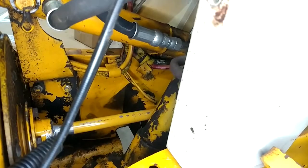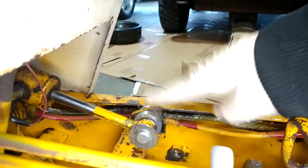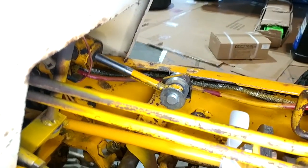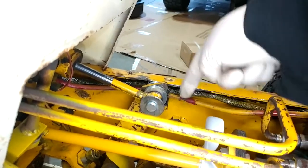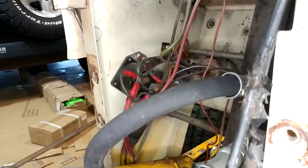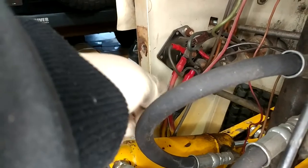The clamping for all the wires is right under the hydraulic lift cylinder — those are wires going forward and those are wires going backward. My linkage will look different than yours because I've eliminated the Cub Cadet stuff and gone right to the rock shaft. There's another clipping point right behind here, so I may end up mechanically disconnecting the cylinder and setting it to the side for better access. I'm hoping I can bend that one out from the bottom so the cable drops out and the new one drops in. Since it's the less tricky wire, I think I'll start with this one — meaning I don't have to deal with the corroded end right away.